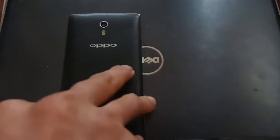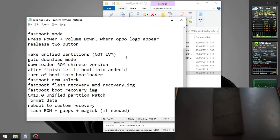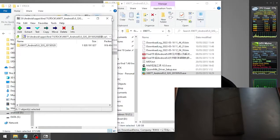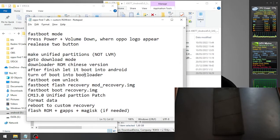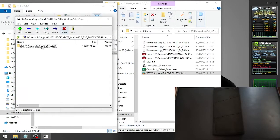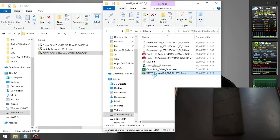After turning off the phone, we need to go to download mode. Remove the battery, then put it aside. You need to download the Chinese firmware file. I will provide the files and steps in my blog — the link is in the description box. Open the file and extract it to a folder. You'll find something like this; the size is about 1.8 GB. Double-click the file and wait, as it's a large file.